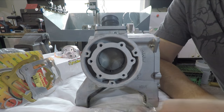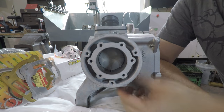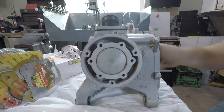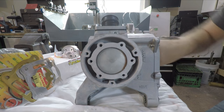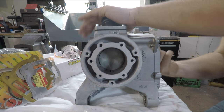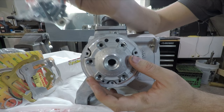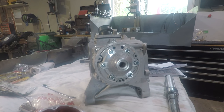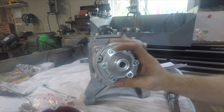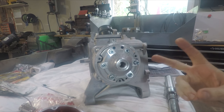Cylinder on. It gives you these nuts. You should be able to roll it over by hand and even get base compression when going down, which is a good sign — it means all your seals are at least somewhat sealing. The head cover goes on just like so — two holes at the bottom closest to the exhaust. There are supplied bag screws for the head insert and cover. This is where we're going to leave it for tonight. I just put the head cap back on to keep the dust out, but we will be setting the squish and probably doing variator and transmission stuff next time. Until next time, take care and thanks.